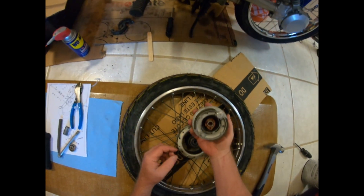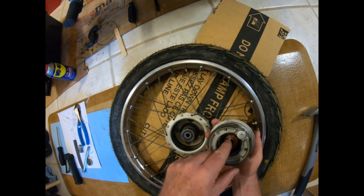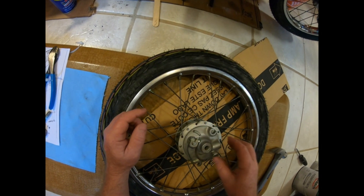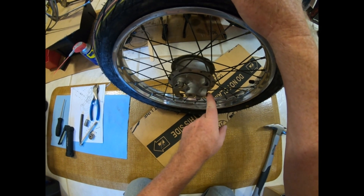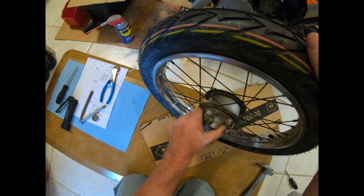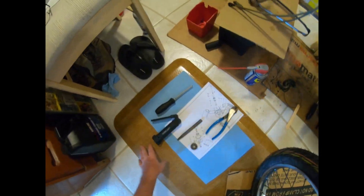Next is the brake assembly. If you look inside you'll see the shape of the drive, and you'll see there's a cutout portion on the brake flange here — you just want the lobes of this drive to fit here. If it doesn't fit firmly just spin it until it does. When it's on, your speedometer cable comes down through here, then the brake underneath through here, and latches on here. The next step is the spacer on this side and the axle, and now it's ready to get on.